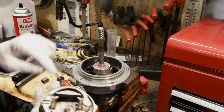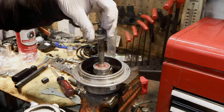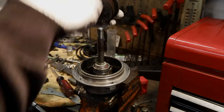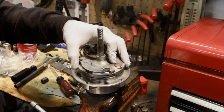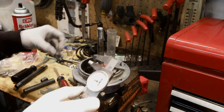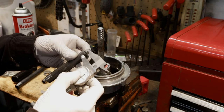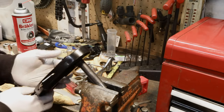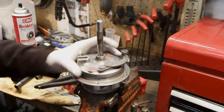But now we do have to make a spacer between the brake plate and the hub bearing. The easiest way is to just stack washers until it fits — two is not enough, three is perfect. Measure the three washers, mark your spacer tube, and cut it. Now we have our spacer. Slide your spacer on, then your brake plate — good to go.